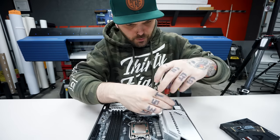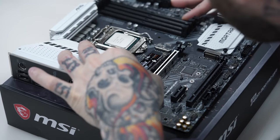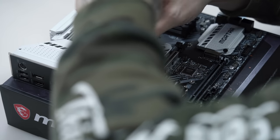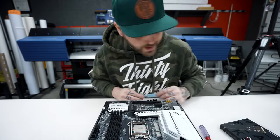I'm adding a 500 gigabyte M.2 drive — a Western Digital Black — really just to get quicker boot times. I'm still gonna add a bigger storage solution. The reason I went with this one? Look at the packaging — that whole Spec Ops look thing got me. It goes behind here, seems pretty straightforward. They've got a little C-clip on the screw so it doesn't pop out — genius. This is going swimmingly so far. I say that after putting only two things on.